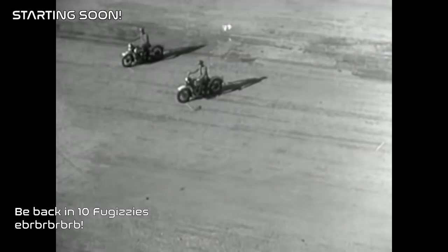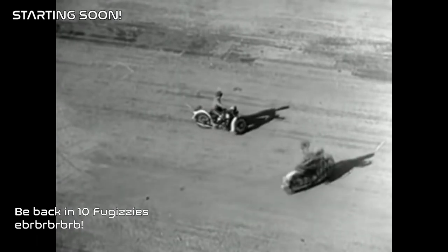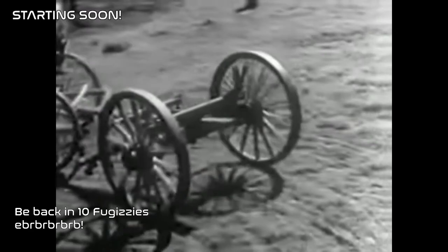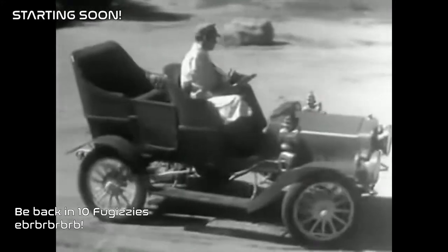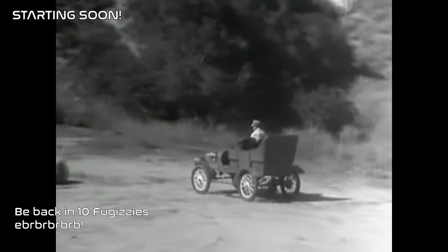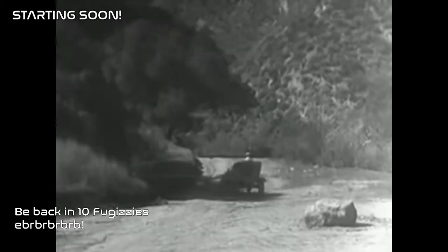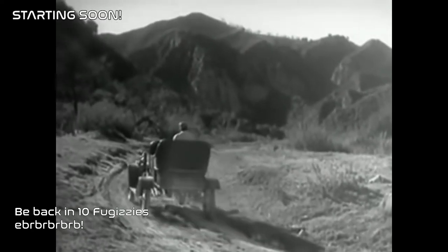The outside wheels must spin faster than the wheels on the inside, because they have a greater distance to travel in the same length of time. When a wagon turns a corner, the wheels can travel at different speeds because each one can turn freely on the axles. And in the early automobiles, the rear wheels turned separately and only one wheel was connected to the engine. But when only one wheel was driven by the engine, it had to do all the work and it couldn't get a good enough grip on the road to do its job properly. So the one-wheel drive was soon out of date.